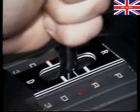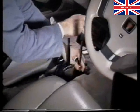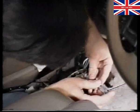If either setting is outside the tolerance band, the selector cable needs adjusting. Adjustment is straightforward, but the procedure must be followed to the letter. Remove the centre console and slacken the cable lock nut using a crow's foot socket. Make sure the cable slides freely in the olive. Select position 2 and slide the cable outer fully forwards whilst holding the lever in position, then tighten the lock nut to 18Nm. Select neutral and slacken the lock nut again, making sure the cable slides freely in the olive. This will allow the selector valve to centralise about the neutral detent. Retighten the lock nut to 18Nm. Now carry out a hydraulic engagement check to make sure the adjustment is correct.